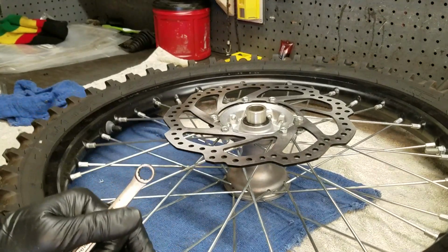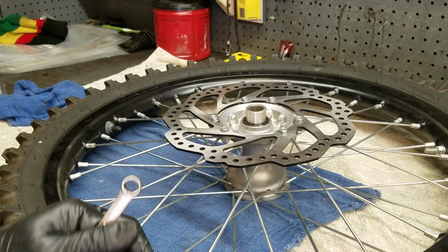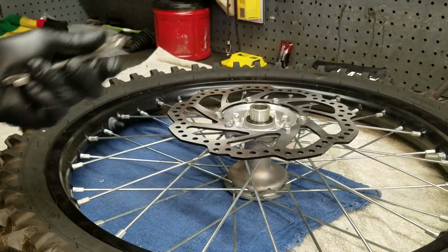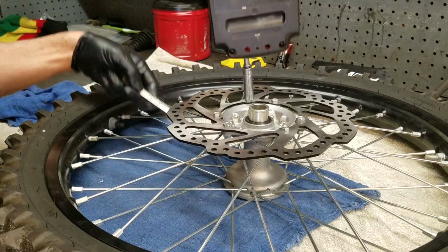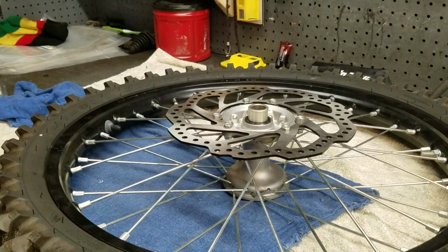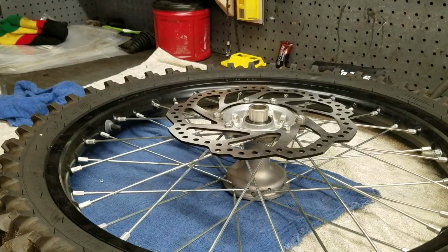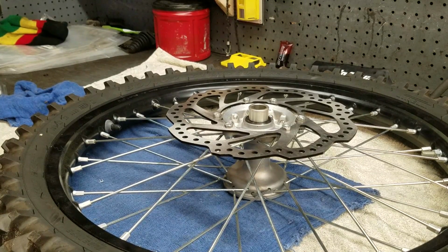Another short ride, 8 to 10 minutes long, and avoid sustained full throttle. And then let it cool down again, another 15 minutes, checking your coolant, oil, everything like that. Check for leaks. If everything comes out good, then go ahead and give it another ride. This time you can make it a full ride, 15 minutes, 30 minutes, whatever. By the third ride, I say it's safe to do a full ride, but just be a little easier on the motor on the first full ride, no matter how long it is.